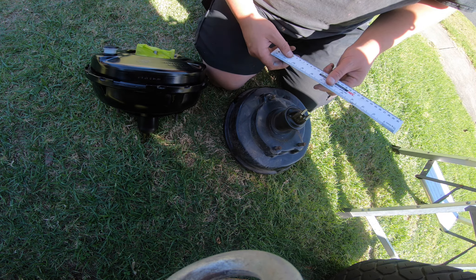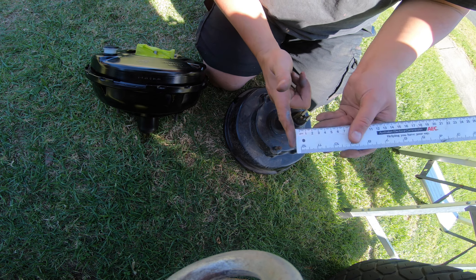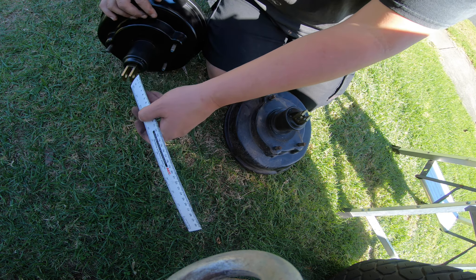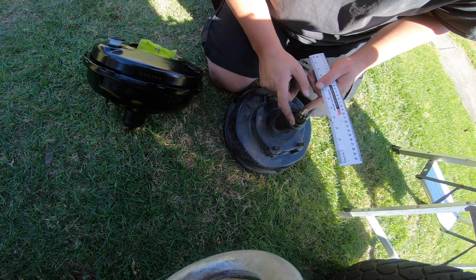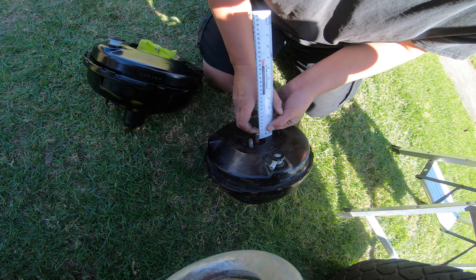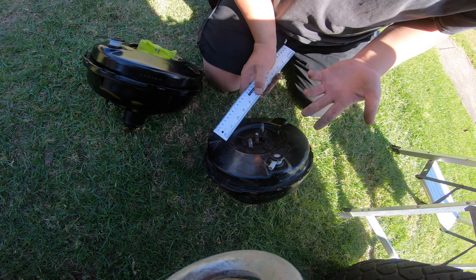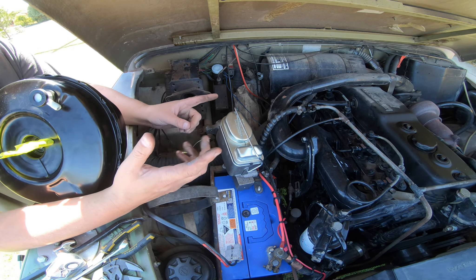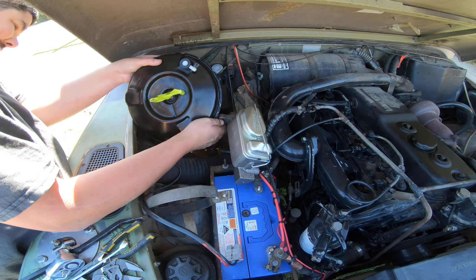One of the members of a Facebook group warned me to be careful of the length of the yoke. This is our old one - I know this isn't an accurate way of measuring, but we'll get an idea. That one comes to 25mm. This one also comes to 25mm, so the yoke length on both is the same - a good sign. Relative to the top, both are sitting out about 15mm. The yoke length is also adjustable, and they appear to be adjusted to the same length.